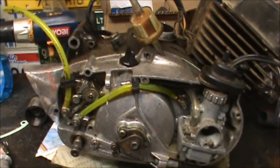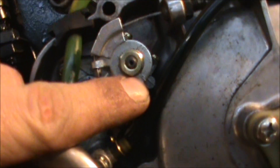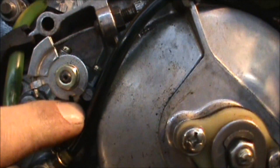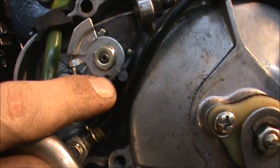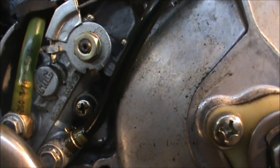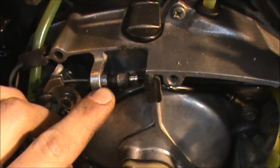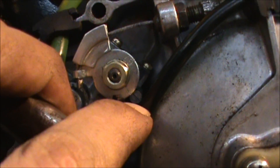I've got another engine here. On the pump, you can see it has a line right here on this little part that moves. There's a line on the inside, and that's how you adjust for richer or leaner — more or less oil. Work your throttle a little bit — I'm running a little rich there. You can adjust this adjuster here: loosen that 10 millimeter nut, back this out or move it in to get that lined up good.